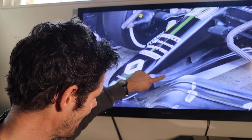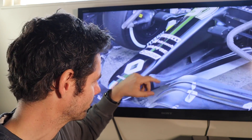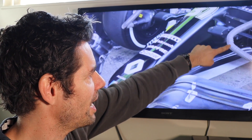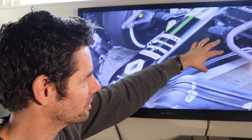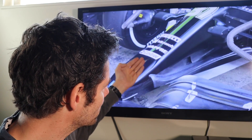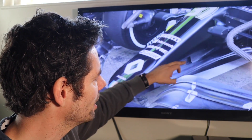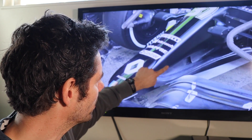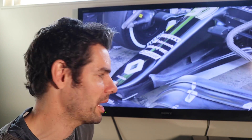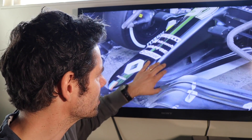Further up, the same thing happens — as I've talked about in other videos on the S-duct. The flow spilling over the top here, which is destined to head into the top of the floor, the bargeboard area, and the guide turning vanes, becomes slow-moving and turbulent as it spills over the edge. This is the S-duct entry point, designed to gather up some of that slow-moving flow passing over here and send it through the S-duct out over the top.